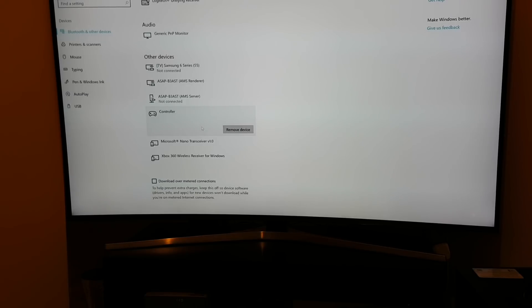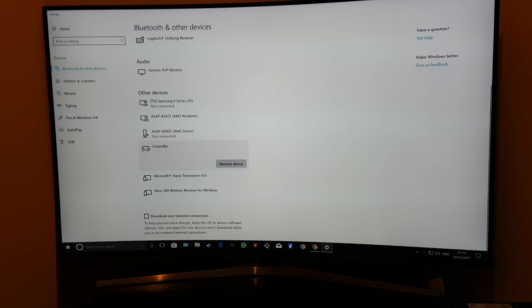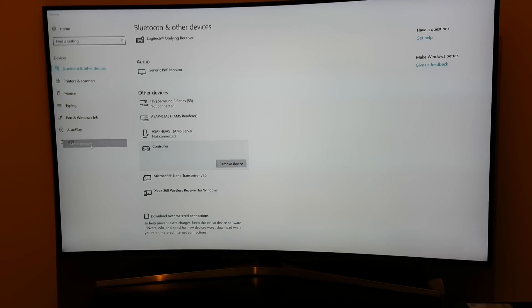If you don't see your controller showing up there, it could be a number of issues — possibly related to the cable or the USB port you're using. The best way to troubleshoot is to right-click on the Windows icon, click 'Device Manager,' and look for the controller connection showing a yellow exclamation mark, meaning it hasn't connected successfully. You may need to do a forced driver installation to resolve that.